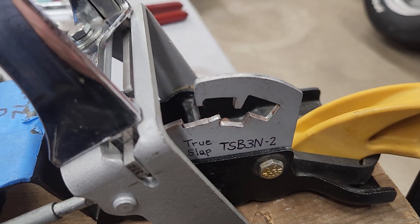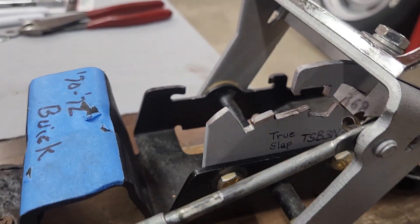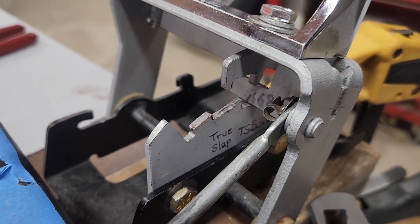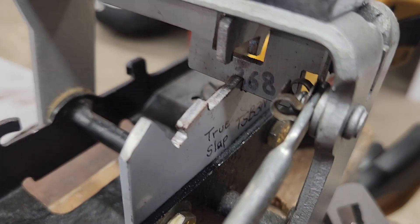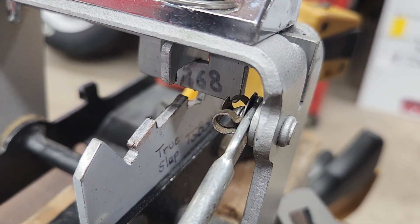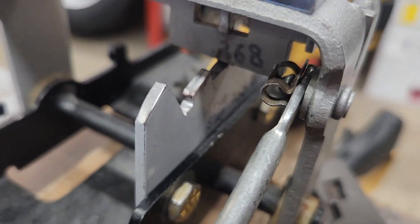So I'll give this one a try. Get my right hand on it — slap it from first to second. Stops at second gear. There's third gear. Squeeze the trigger, simply push forward while you're holding the trigger and it hits that stop — you're in. It's in neutral.